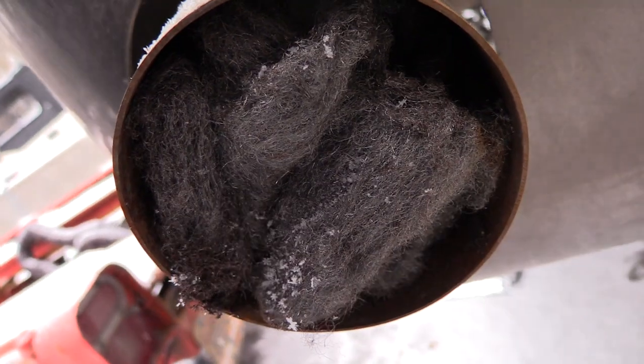That one tip: steel wool. Sometimes if you leave your block heater on, even just naturally, the engine's a little warmer than the other part. It's got more mass to it. It'll absorb some of that heat from the inside. Rodents, nibbles, I call them little mouse nibbles, will find their way in there and take shelter and bring a whole bunch of their friends in. You don't want that. Steel wool, they can't bite into that, or maybe they can, but we'll find out. But put steel wool in other places too, like by the wet bay and wherever you have wires or cables coming up that they can climb up into.